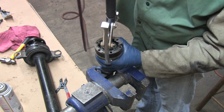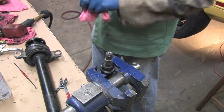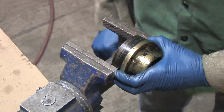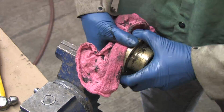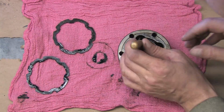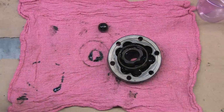Connecting the engine to the rear wheels is the most critical part of doing an all-wheel drive swap. Matching up the wheelbases will require messing with the drive shaft to get its length and pinion angles correct. It's just part of a process that everyone would have to do if they're attempting this job, and I intend to share my complete experience of the Colt's transformation. That's why you're seeing it again at warp speed.